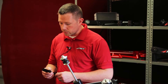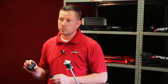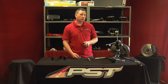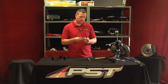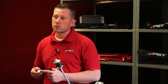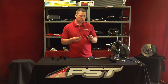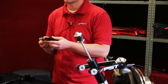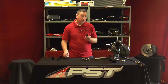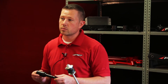The nice thing about our greasable pivot shafts is that you'll see we run a polygraphite bushing. Originally, when we used to offer polygraphite bushings, you could still use your standard pivot shaft, but you had to retain the original sleeve from the OE rubber bushing that was installed. With our greasable pivot shaft types, the ends of the shafts are actually larger in diameter to compensate for that sleeve, so you will no longer need to use the sleeve when installing into the polygraphite bushing.